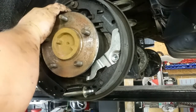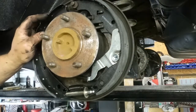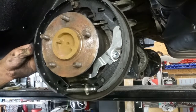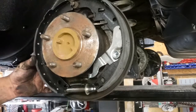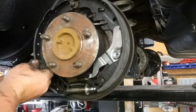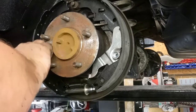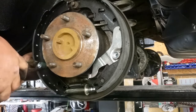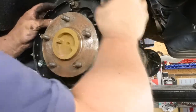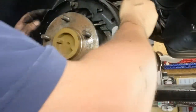Okay. Now we're gonna put in this spreader bar on this side with its spring, and then we're gonna put that all together like that. Now the spreader bar needs to go in. There, like that. Now this side doesn't have to have all that extra stuff. On the other side, the emergency brake cable is part of the front, so it's less work to get that to spring on. You gotta make sure all these keepers are in. Shoe is all good. Just like that.